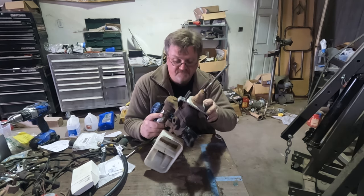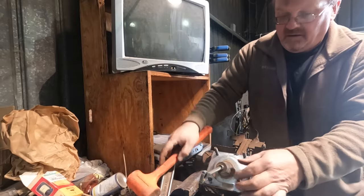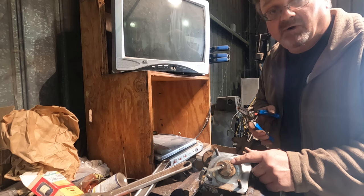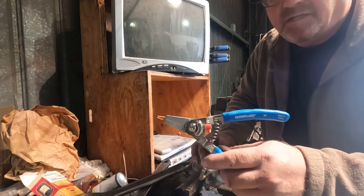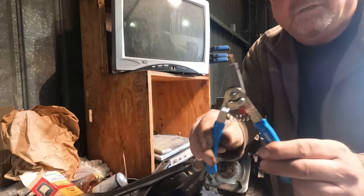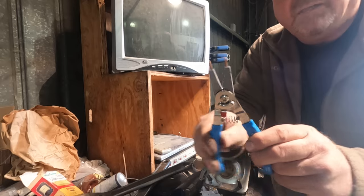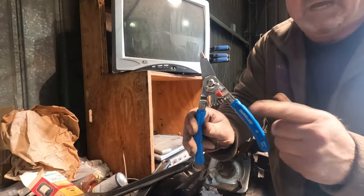Let's take this off and see what we've got. It's a little tight — there's a snap ring here, don't forget to take that off otherwise the nut won't come off. I just learned that. These channel-lock pliers are the best I've used for snap rings — they've got a switch on them. That expands them, flip the switch, and it retracts them. Easiest setup I've ever seen.